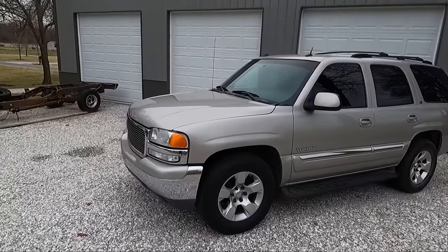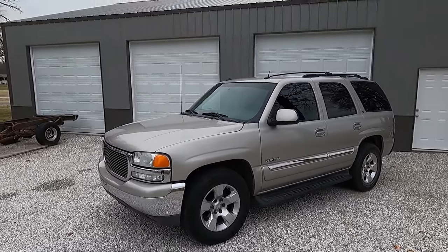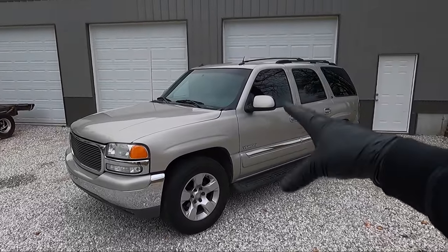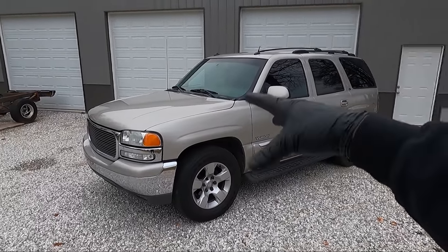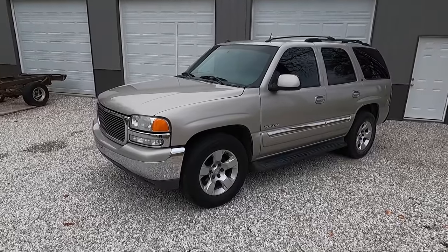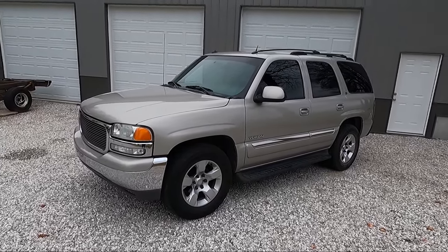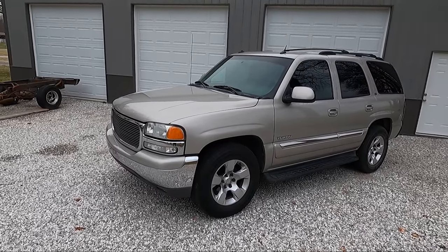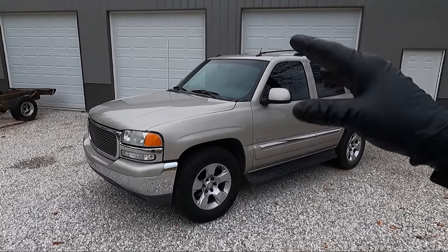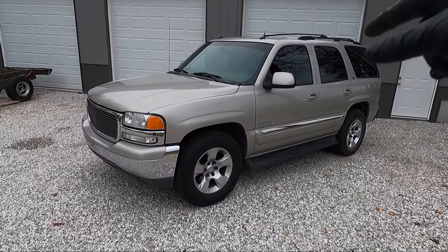I really think, guys, that those aftermarket throttle bodies are garbage. If you're going to replace one, especially on GM, now it may not be the same for every company, but on a GM vehicle that is drive-by-wire, I think that your best bet is to buy a GM throttle body. I've just seen too many instances where they're bad out of the box, and that goes for the 2007 and up as well. I specifically, when I did the Suburban, bought a GM throttle body.